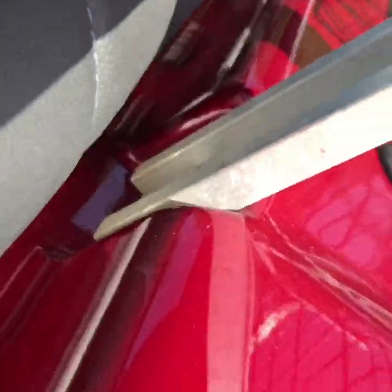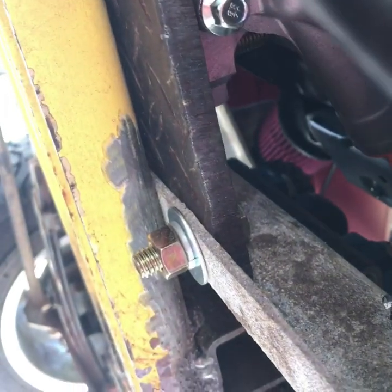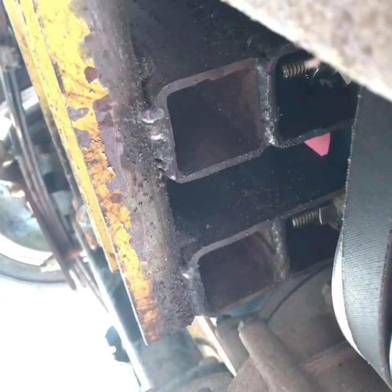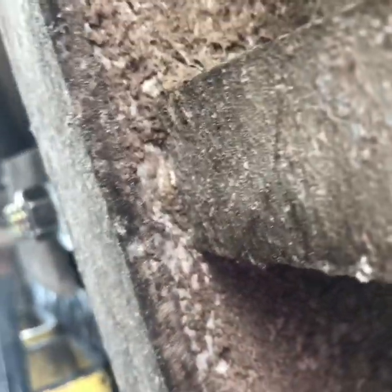Now I'm going to show you how I did my jackshaft — I'll climb underneath there. I left it yellow. The jackshaft bolts right under the motor plate, and it sandwiches in between the motor plate and the aluminum in the car, which makes it really strong. That's how I mounted my jackshaft plate. It wasn't that bad — it's just that everything has to bolt in.